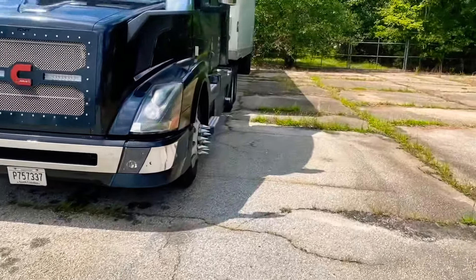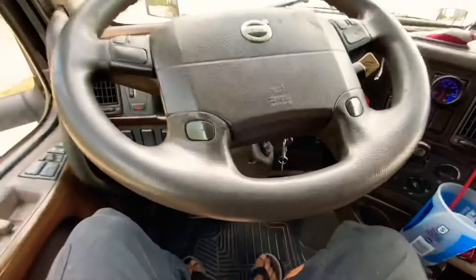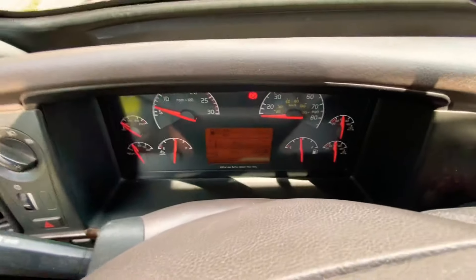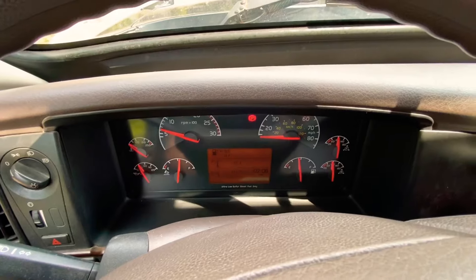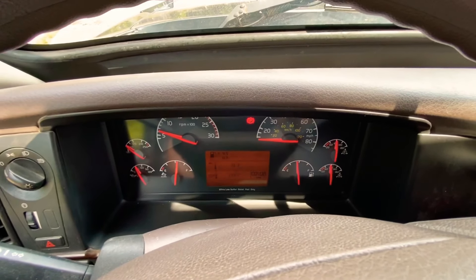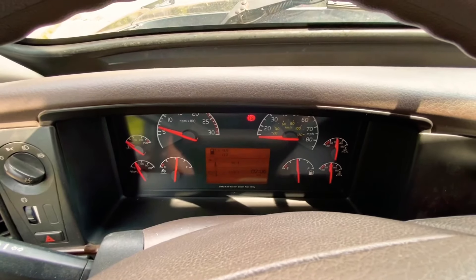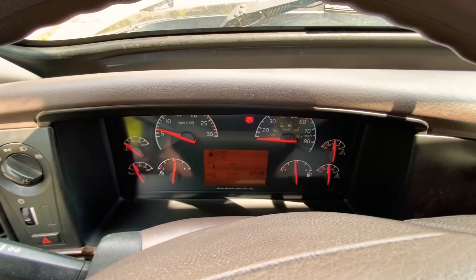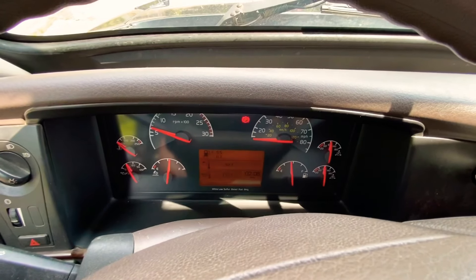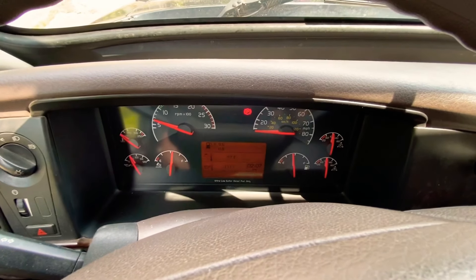Off to Alabama. So I went to Walmart and grabbed an Easy Chill all-in-one with a gauge and 18 ounces of refrigerant. As soon as I hooked that thing up to the low pressure side and pulled the trigger, the fan clutch engaged and started to spin — that wasn't happening before. So it was low on refrigerant. I think what may have caused it was the heavy rain getting extra moisture inside the filter box, which let it freeze up. I turned the heater on for 10-15 minutes before I shut it down last time to sauna and evaporate that extra moisture.